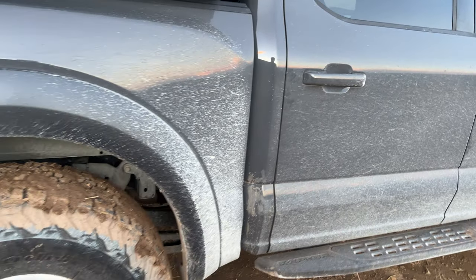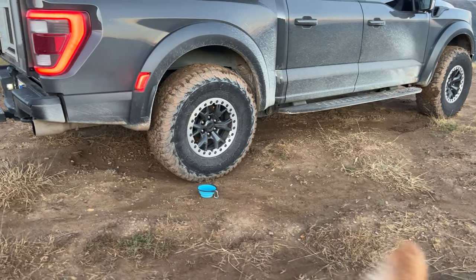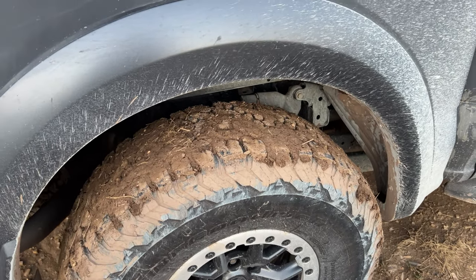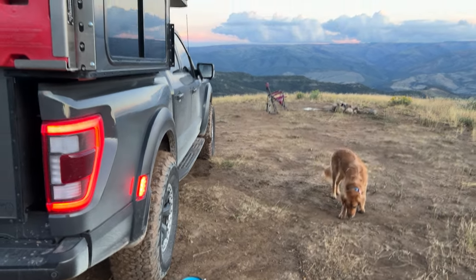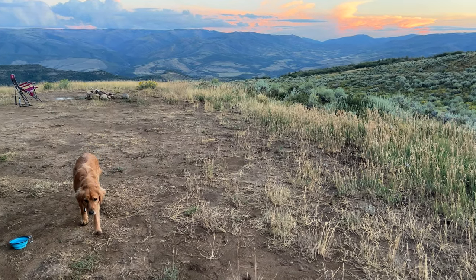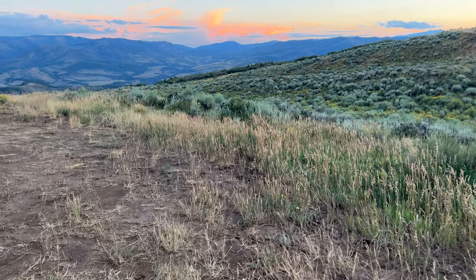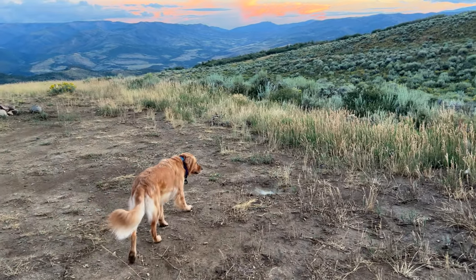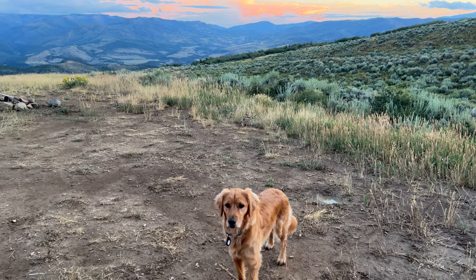Other than that I haven't made a ton of mods. This truck has been lifted a little bit with the spring collar perch, which is too dirty to see, but that's just a one inch block. I'm awaiting something beefier to come out — a spring or an airbag kit — neither of which has hit the market yet for this new coil spring design. Anyway, those are my two latest mods. Thanks for tuning in, maybe I'll see you on the trail.